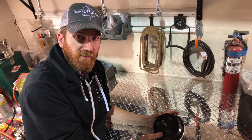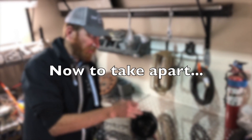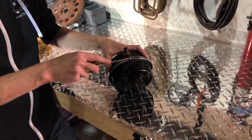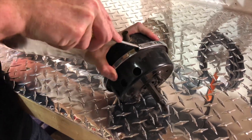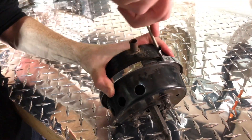So that's how you test your clutch servo. Since this unit needs a new diaphragm, we're going to open it up just to get a better internal look at the diaphragm and what's inside.